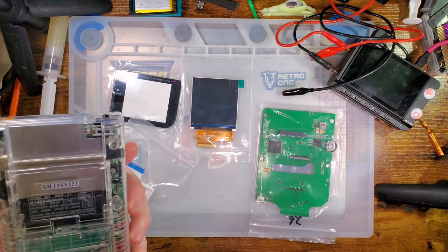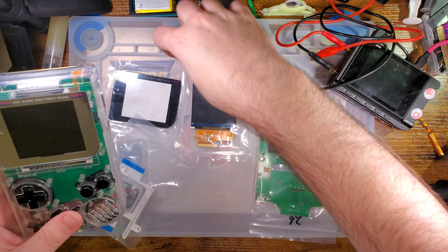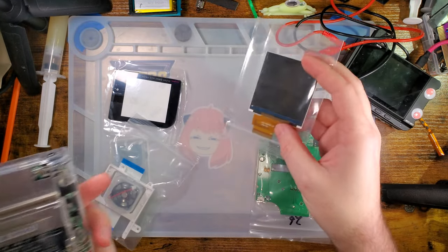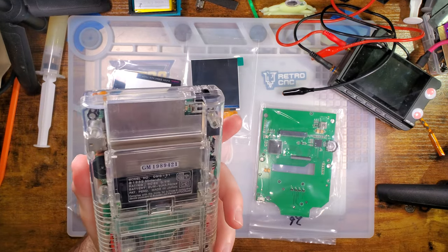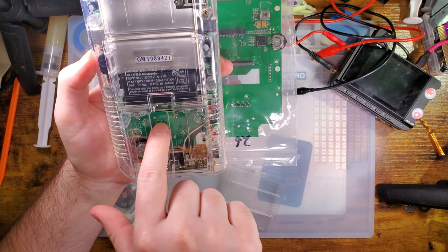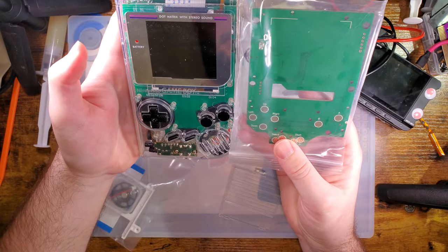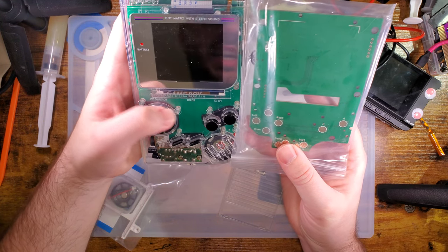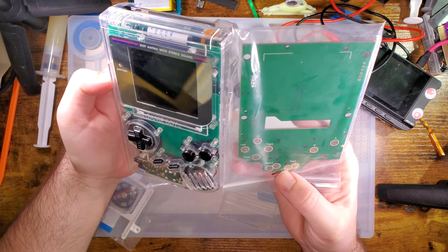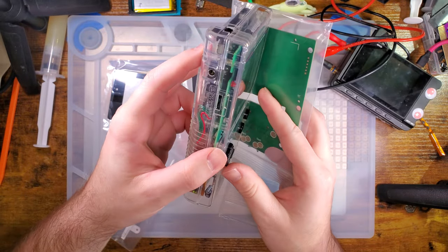I'll link that in the description and later on in the video we can compare what's changing and what's different. The LCD itself is the same LCD between these two backlight kits, but the front board definitely looks different. The old one doesn't have the diode array on the back for the buttons, whereas the new one does — the old one just has individual diodes for each button. In the shell it's pretty hard to see explicit differences. Oh, there's a capacitor on the old one that isn't there on the new one.